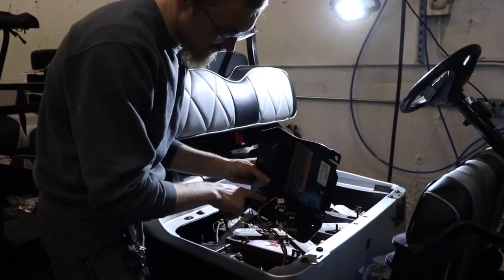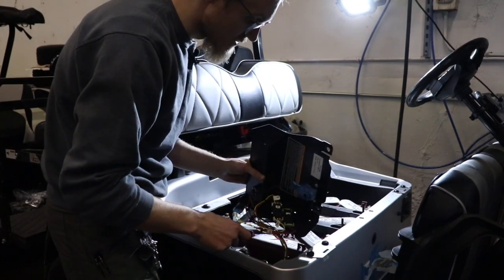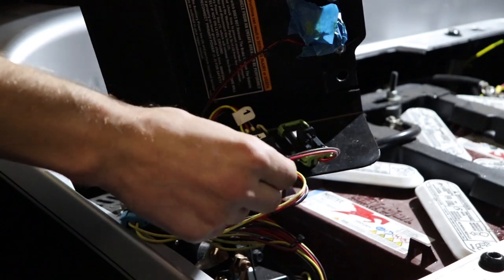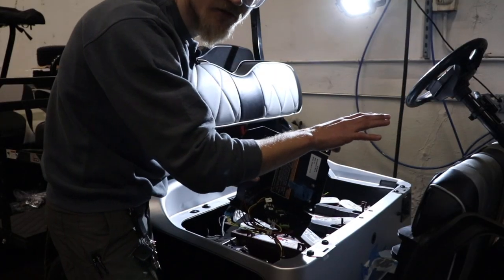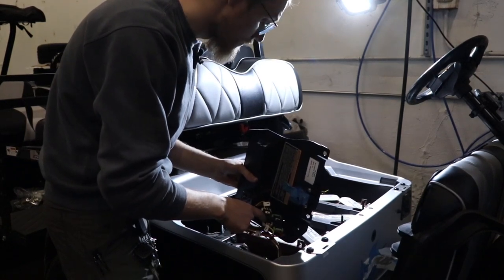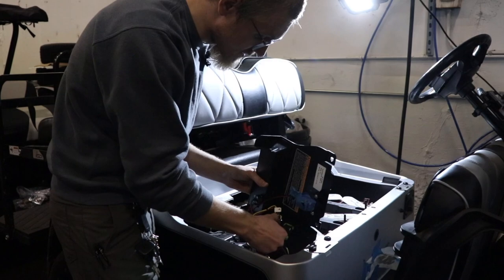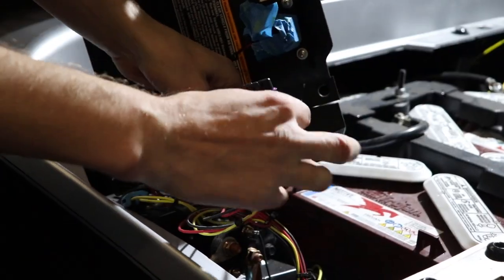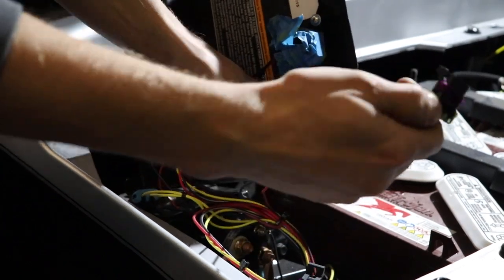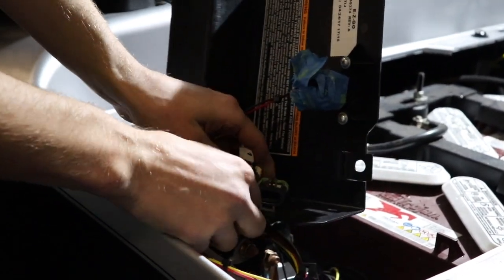What it's going to tell you is you have one, two, three, and four connection switches here. The one and the two are your cart's normal run operations and they function normally when your cart's functioning normally, but they don't function normally when your cart isn't functioning normally. So, what you're doing here by removing this switch and swapping over is providing direct 48-volt power to your motor brake to release it.